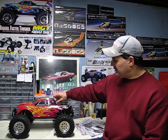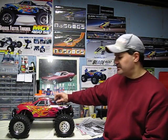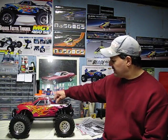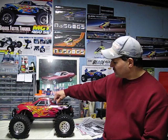You have to have some kind of a heat gauge. Losi makes a good one, or if you're running a telemetry system, you have a way of checking the temperature, the heat on these engines. Guys, you can't really mess around with these things without it, because how are you going to know what temperature it's running at? So you either have to have a temp gauge, or you have to have a telemetry system, which is going to tell you on your actual controller.